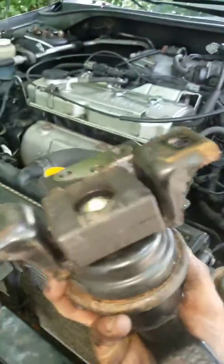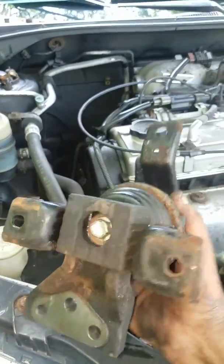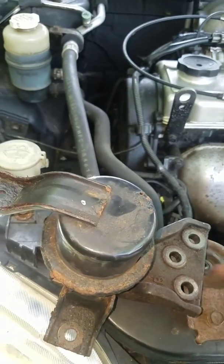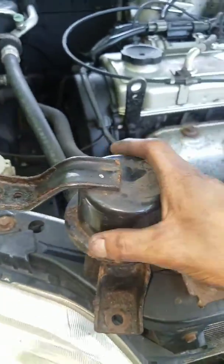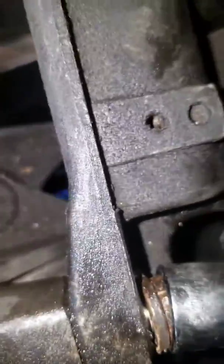Here's how you have to take it off — it sits like that. You have to remove the three nuts on this side, and the three bolts on this side, because this bracket part is bolted to the bottom. If any of your mounts are sagging, you're going to remove all these — it's going to be really tight. You're going to have to jack up your engine just a little bit and then it'll just literally slide up. But we're making progress, we're almost there. I wish I didn't have to deal with this bracket. I'll keep you updated — hopefully no more surprises.